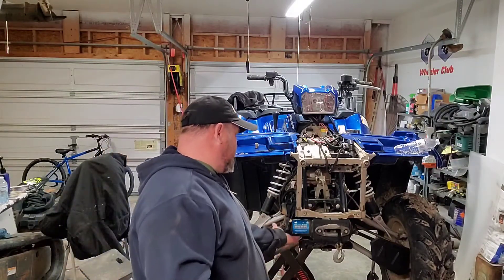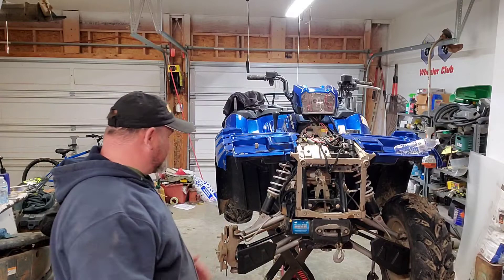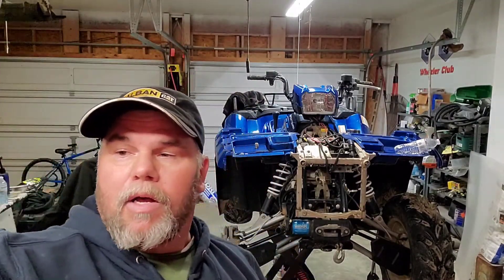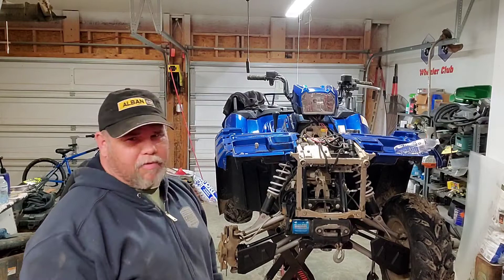It's kind of a straightforward thing. You're going to have to remove the front winch — that gives you a little better access to getting the bottom A-arm bolts out. I also have all new ball joints for this thing. One of them was completely shot so we had to replace that before we went to Hatfield.